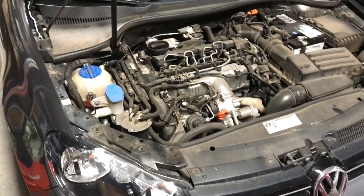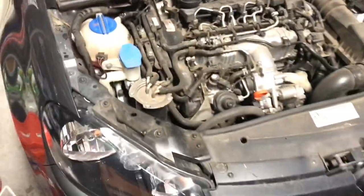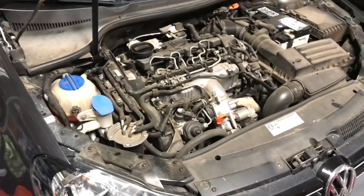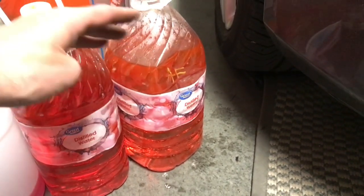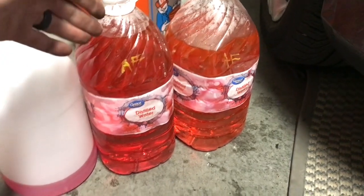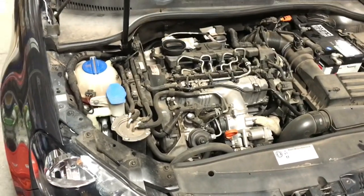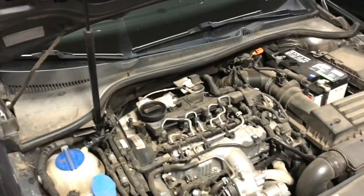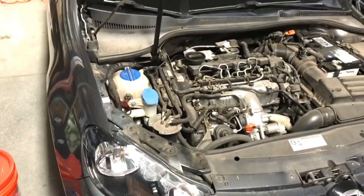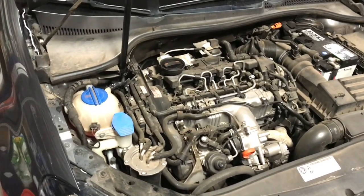That's my experiment doing a coolant flush on a 2012 Jetta Sport Wagon TDI. I've never seen a coolant system with this return line, but I think it's pretty cool — that was the easiest coolant flush I've ever done: no messing with radiator hoses. The first gallon was much redder with old fluid, the second started getting pinker, and by the third I was getting perfectly pink fluid. My main takeaways: the concept is sound, start with a hot engine, and have an assistant hold the throttle at 2,500 RPMs while monitoring fluid color so you're not wasting coolant.